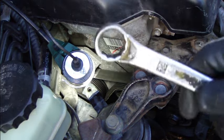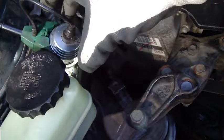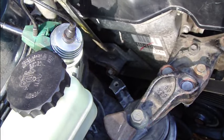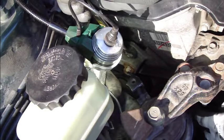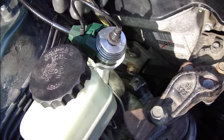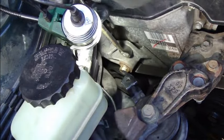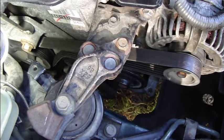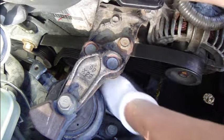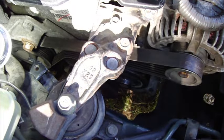When this happens, I only need to take this 19 millimeter socket, and I set up this socket in here, and then I pull that, and at the same time I adjust this belt a little bit in here, down area. Let's look at how this works. Okay, now I pull that, and at the same time I insert that in. Okay, now it's well installed. Okay, and this was the final part.